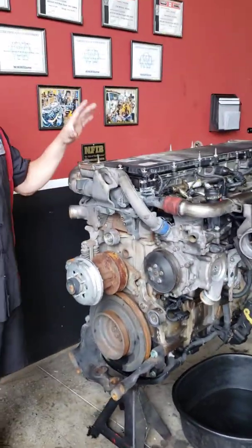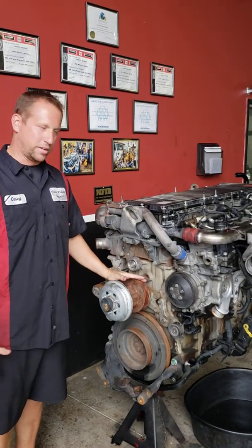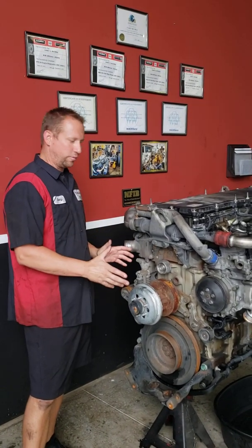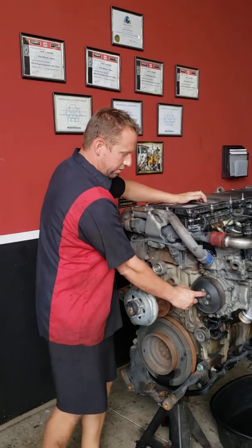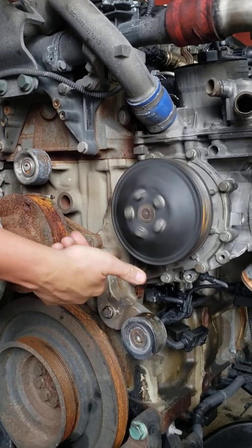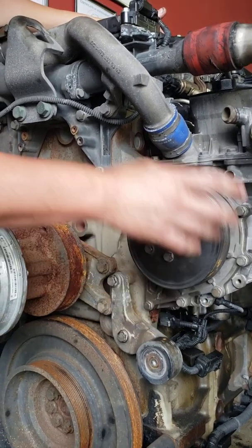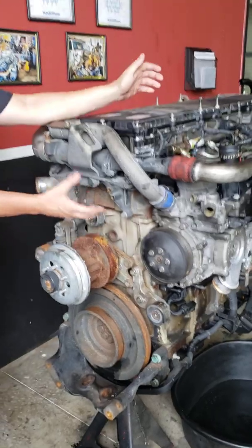Now I know this engine is out of chassis, but I promise you it's just as easy in chassis as it is out. We don't have a belt on this engine because we don't have an AC compressor and alternator on this engine, but I will do another video showing you how to get the belt off. For purposes right now, the belt's already removed. When you start this, you're going to want to loosen your pulley bolts before you pull your belt off. The reason why is this pulley spins when there's no tension on it. If your belt was on here, it would hold tension. Just loosen the bolts — don't take them out. So the first step is drain your coolant, loosen your pulley bolts, and once they're loose, remove your belt.